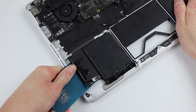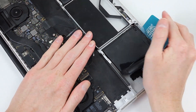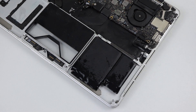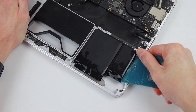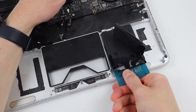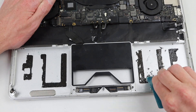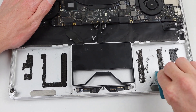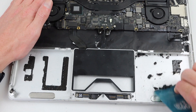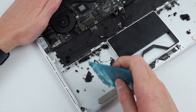For the battery, I'll be using isopropyl alcohol as Apple no longer screws in the batteries for their MacBook Pro models. Apple went from hot-swappable batteries to using security screws to now just gluing it into place — not only is this harder for third-party repair, but even Apple themselves. The isopropyl alcohol will help soften the adhesive underneath, and then I can use a hard plastic card to break through the adhesive, releasing the battery cells. With our battery cells removed, I need to clean up the residual adhesive using some special adhesive remover. It's disappointing to see the battery was glued in — similar aged MacBook Airs use screws instead, which is a much better method and makes battery replacements so much easier. You can see just how long and how much scraping is required to properly remove all of the old adhesive.